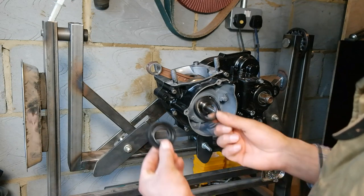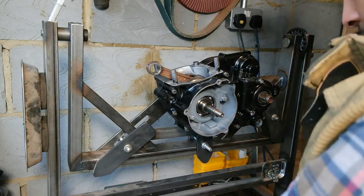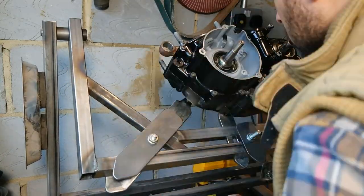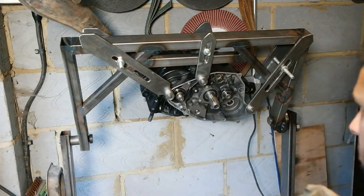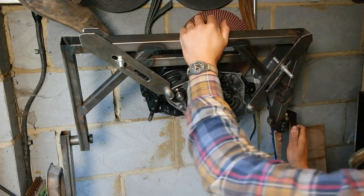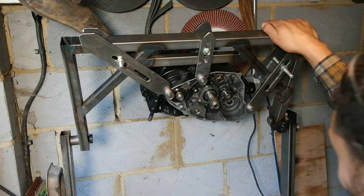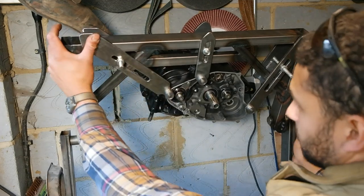Just two minutes ago the postman knocked on the door and delivered two crankshaft seals - I wasn't expecting them today, but that's great, so I'll put these in now while I'm here. There you go - there's that little retaining clip, and I cannot see that thing falling out. That was very, very tight - usually they're not that tight, that one took a lot of persuasion to get in there. You've got to be so careful when installing them - if you go too far, chances are you've got to split the case to get them back out because there's no race on the inside where you can press the seal up. It can go too far. It's not something you want to do after all this hard work and then drive that seal home too far and have to split it again.